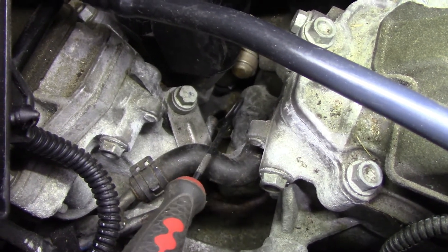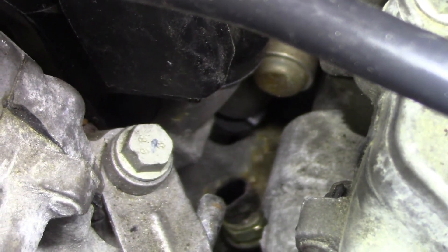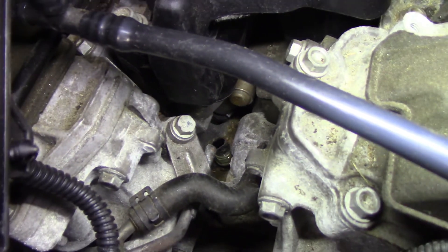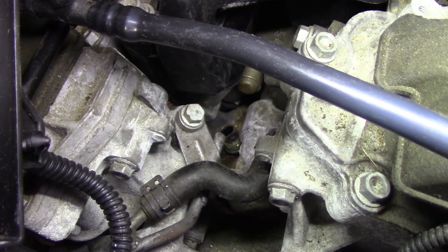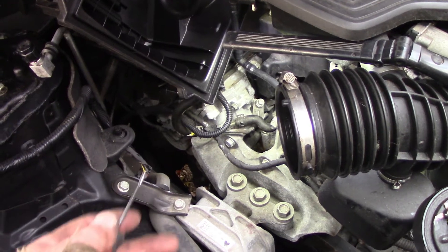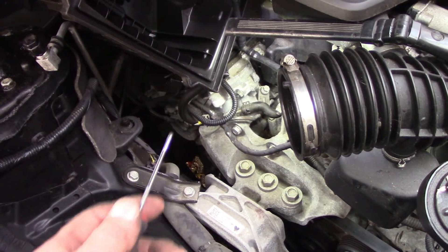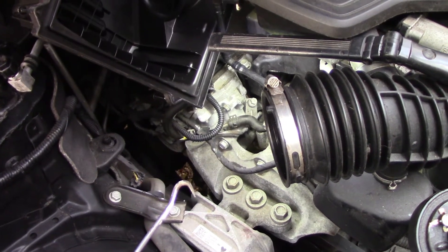I think I can make a tool that we can slip down here on a rod. All we need to do is crack this thing loose. Once we get it cracked loose, we could stick a slotted screwdriver into that plastic housing and screw it out. We've got to get it cracked loose, and we also need that tool when we reinstall it because there's coolant behind there. I'm not emptying the coolant out yet — I'll pull it up on ramps and let the coolant flow down. But I want to get that cracked first before emptying everything, because if this doesn't work, I may have to take the intake off.